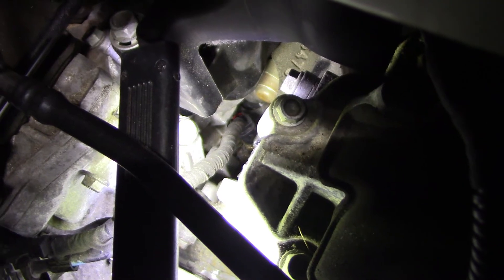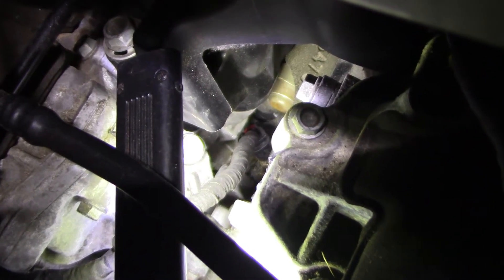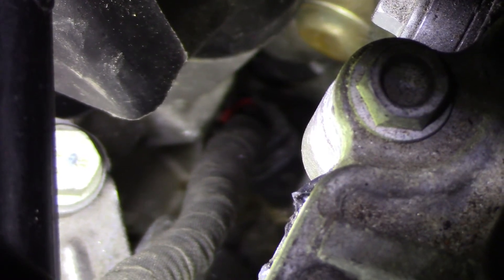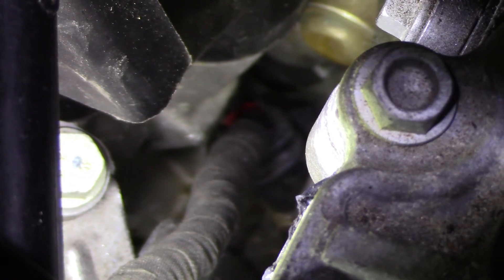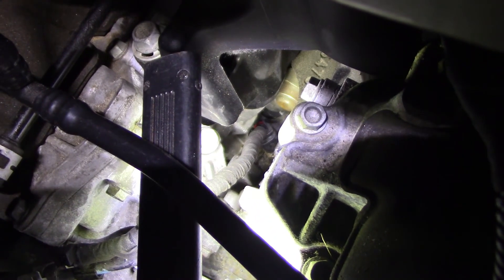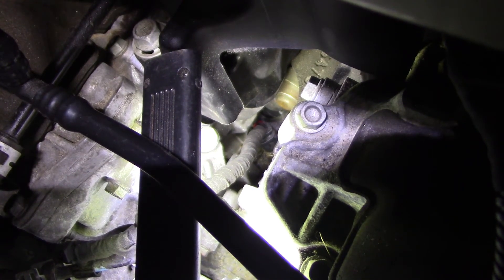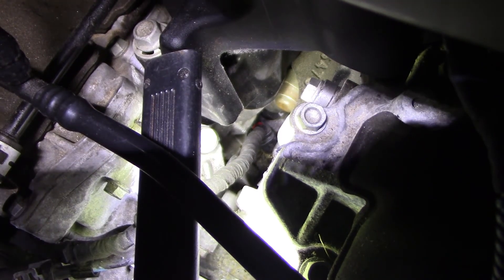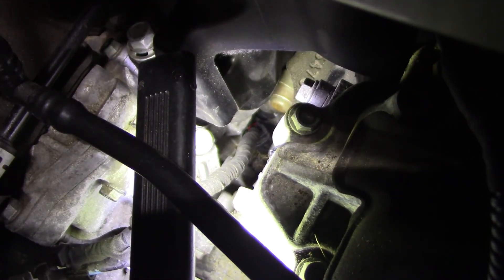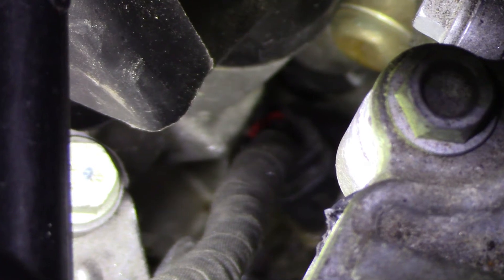Putting the wire on was a bit of a challenge too. I ended up taking a long pair of needle nose and grabbing the plastic part up by the red clip, guiding it in and getting it started. Then I took a long flat-bladed screwdriver and finagled it into the hole. The tab ended up on the other side after seating the new sensor, but since it's oval it doesn't really matter — it's just a little more challenging getting to that red clip if I have to do this again. Getting the red clip up was the easiest part. It's easy when you can see what you're doing, but when you're doing it by feel, it's a little more challenging.